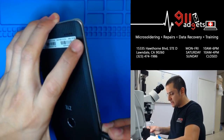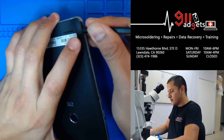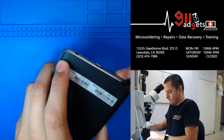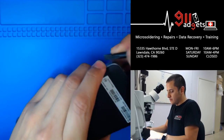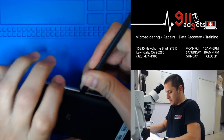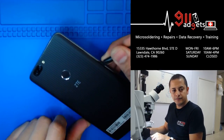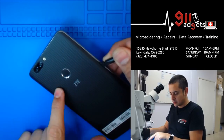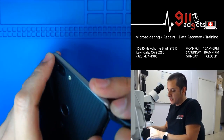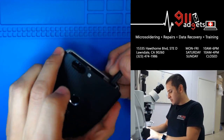Around the edges, there's adhesive. You could heat it up just a tad bit. I'm not gonna do it, but you can. But just be careful because it's plastic. And be careful with this fingerprint sensor, because it has a cable that runs along this side, if I'm not mistaken. So you always want to just be careful when there's any type of buttons or fingerprint sensors in the back. Take it easy, take it slow.